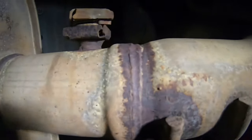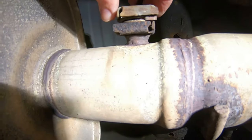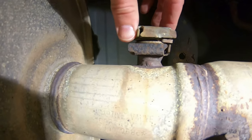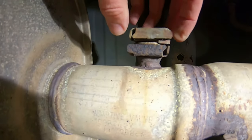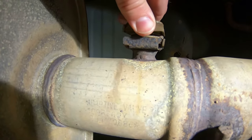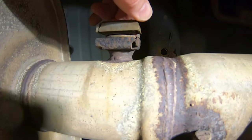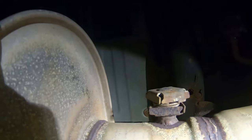What I'm gonna try using here is a number eight screw. In its normal state, when you start up the truck you can see it quickly jumps to just a slight bit open with the exhaust flow. I'm assuming the valve sits straight up and down, so we're going to turn it 90 degrees so the valve is open. I'll put a screw right through here to hold it open, but I need to pry it open just a little bit to fit the number eight screw.